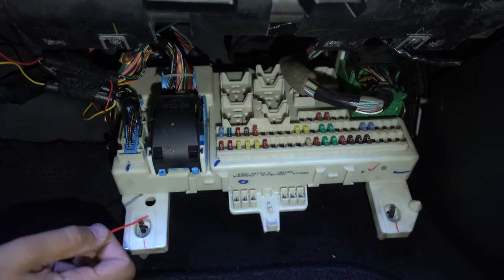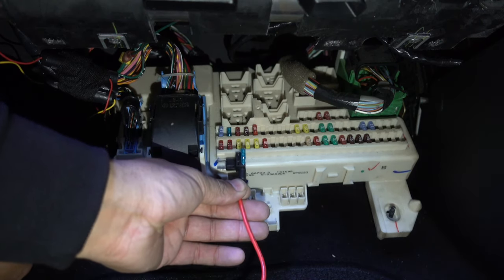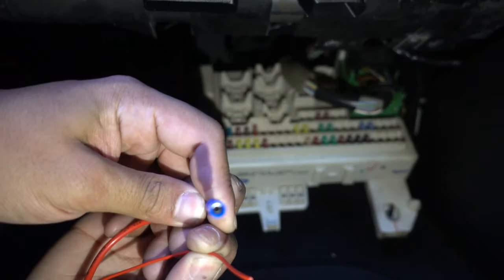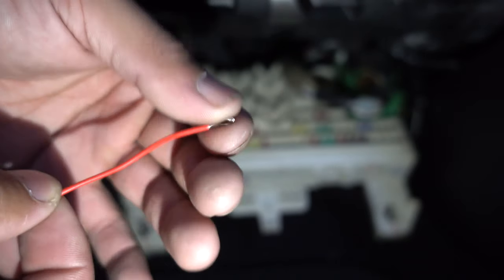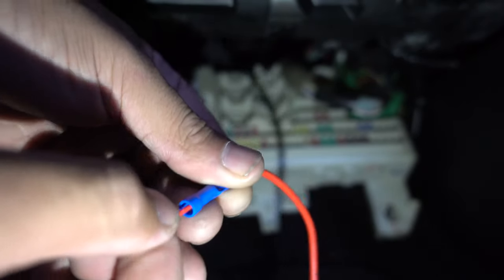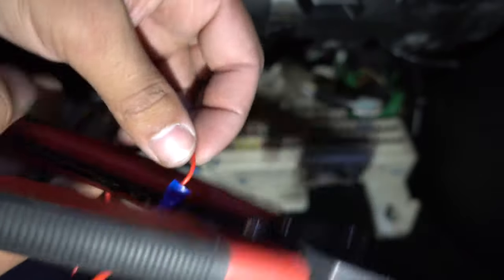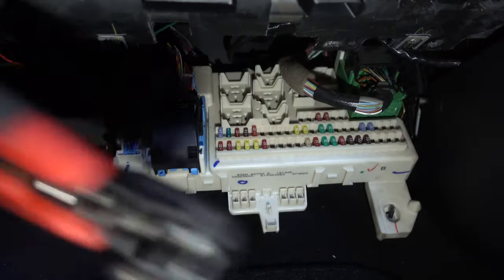With the red wire, we need to look at the size of the fuse — it's clearly not standard size, it is a mini. Strip the red wire, fold the copper over itself once it's stripped, then feed it into the blue part of the add circuit. Make sure it goes into the actual metal part inside that blue area, then use some crimpers to crimp it down over the whole thing. Make sure it's completely crimped — beautiful, solid crimp connection.